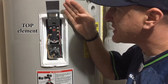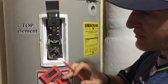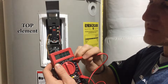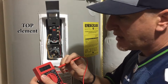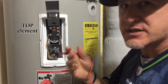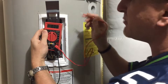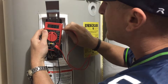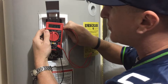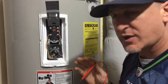I've pulled that safety flap up and taped it to the top so I wouldn't have to deal with it. Now set your voltmeter to 750, because if you set it to 200 it's just not going to read. It should give us a reading between 220 and 260 or so. One probe on each leg — these don't need to be red and black, they don't need to match. I do have 245, 244 volts coming in from my main power into the two legs at the top. So we're good there. Now let's kill the power and start testing components.